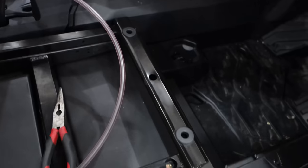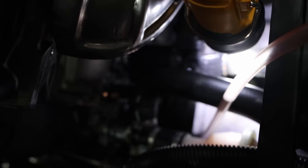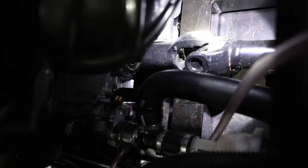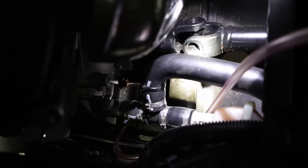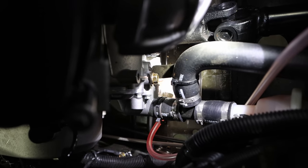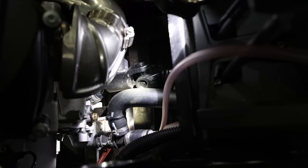You're going to see a new hose here that goes to your water pump way down in there. You're going to see some sort of strange inline filter that is for the coolant. Right underneath that gold bolt, that's where you're going to find a very short hose that has to be replaced with this long one.